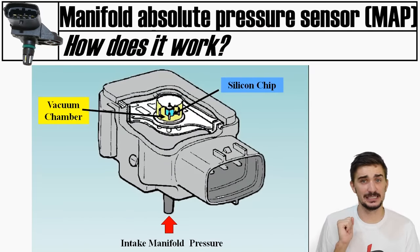The IAT sensor is often integrated into the MAF or AFM. If it's not there, you can usually find it somewhere in the intake duct, near the throttle body. AEM has an IAT sensor suitable for performance and racing engines that is easy to install, reliable, and accurate. If there is only a bit of dirt on the IAT sensor, malfunction symptoms are very mild and barely noticeable. If the fault is more severe, the engine may run rough, stumble, stall, or have short mild surges of power.